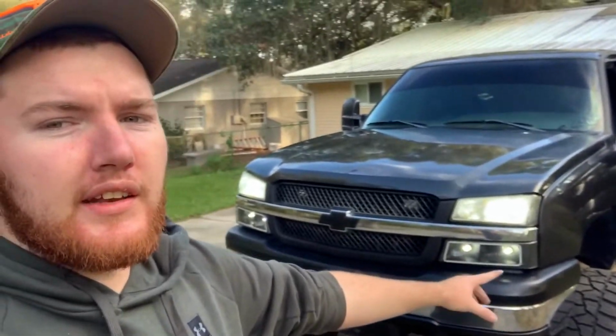But when I order these switchbacks, I think I'm gonna order a new turn signal bulb socket. That one is a little touchy. I had to bend the prongs out on the bulbs, like you guys saw me do when I installed the new taillights with the reverse bulbs. I kind of had to bend these bulbs out a little bit to get a good connection on just that one. The other ones worked fine, but just for that one turn signal bulb, I had to pull the prongs out just a little bit. For whatever reason, it wasn't getting a very good connection, and now it is, but I had to be very careful with it, getting it in. It kept shutting off intermittently every time I tried putting it in. Now I think I finally got it. If I had to guess, if I hit a big bump or anything, it's probably gonna shut off again, but it's the risk I'm gonna take for a couple weeks. So like I said, when I order the switchbacks, I'm gonna order that new bulb socket.